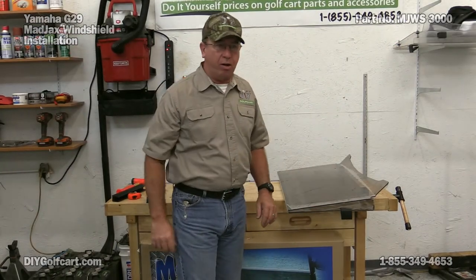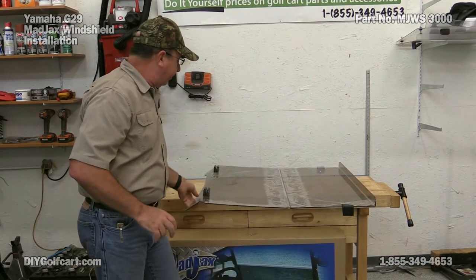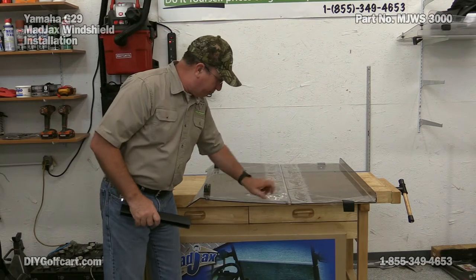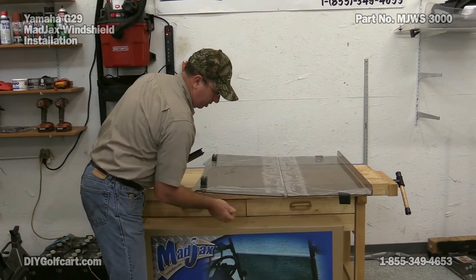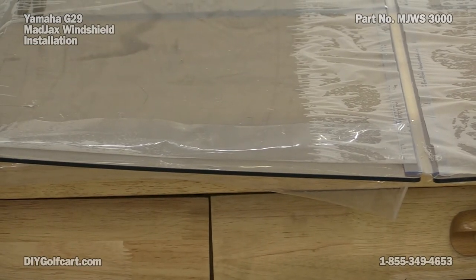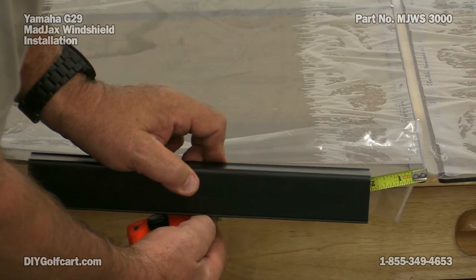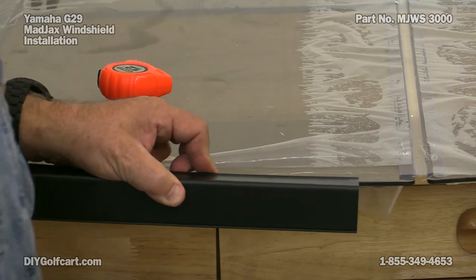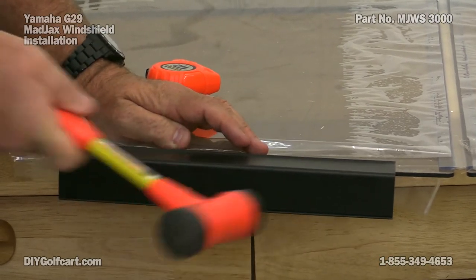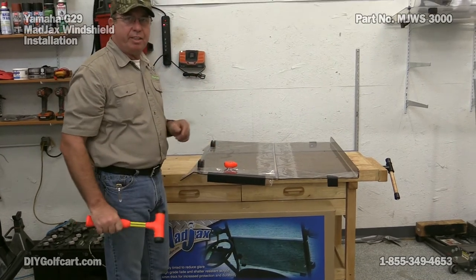Before we get this windshield on the car, we need to put the side extrusion pieces on — that's what's actually going to hold it to the car. First thing we need to do is find a nice soft place to lay it down. This has got the locking blocks facing up, which means the extrusions are going to go on facing down. Let's just pull the plastic back. We want to get this edge capped on the side of the windshield, and we're going to want both sides to be pretty much equal. You can actually measure down from the crease — I'll set this one at about two inches. Using a rubber mallet, dead blow, or just any type of hammer, lightly tap it. Then we'll turn this thing over and do the very same thing to the other side.